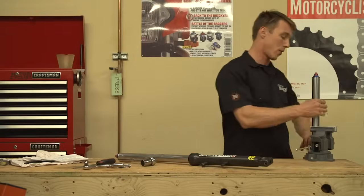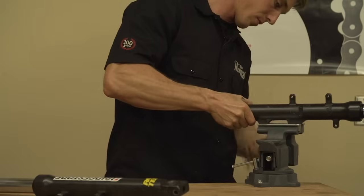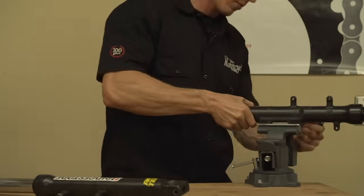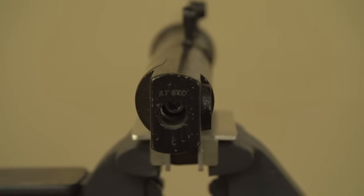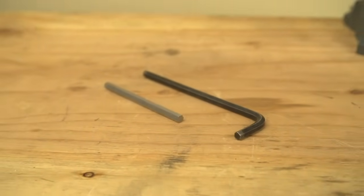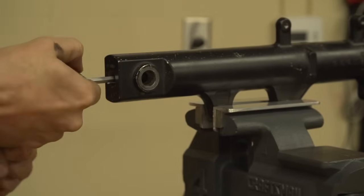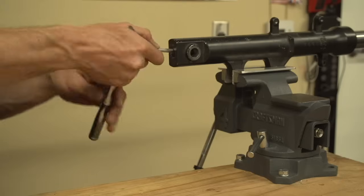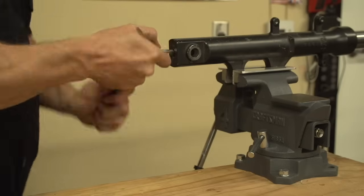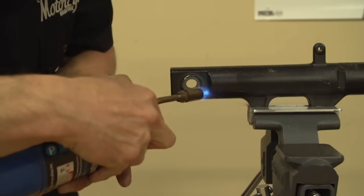There's also a bolt at the bottom of the fork tube that we need to loosen. The bolt at the bottom of the fork is too recessed to be accessed with your average Allen socket, so it may be necessary to buy a long-reach piece or improvise by cutting the foot off a spare Allen key and then turning it using the appropriate size socket. Just loosen the bolt for now, and if it's extremely stubborn, applying heat from a propane torch will help get it free.